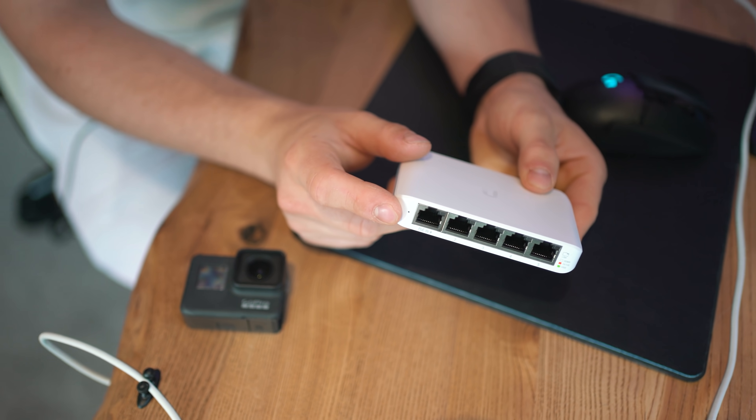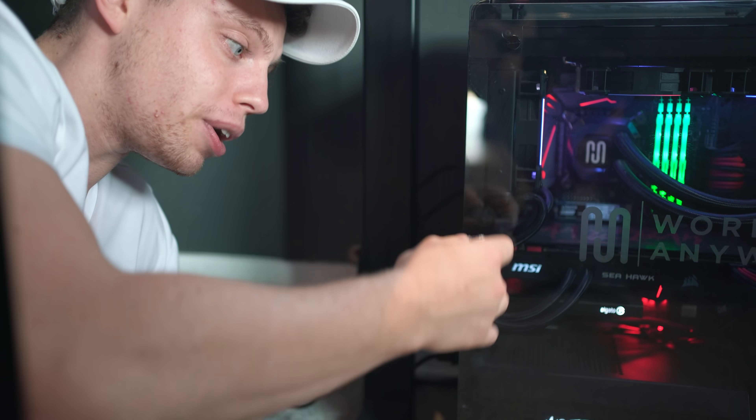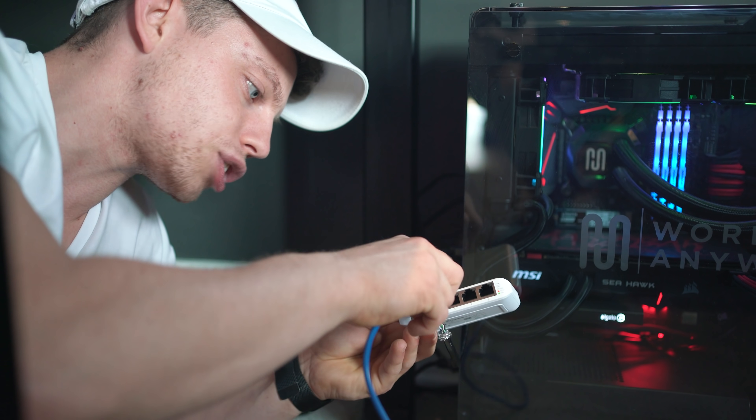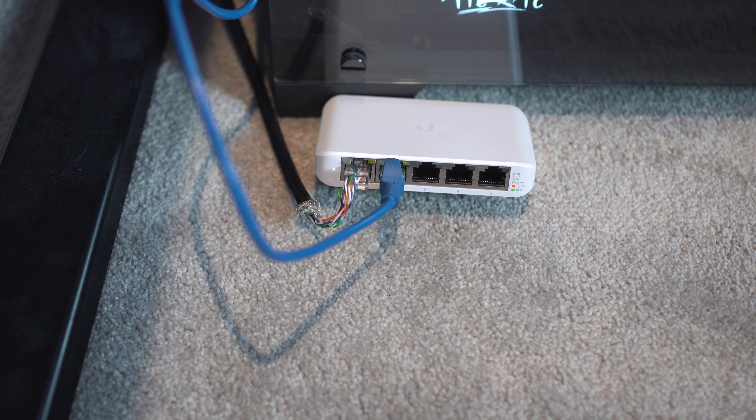This is really kind of funky — we're going to be putting that huge antenna on my roof in a little while. But this is a brand new switch from Ubiquiti that's going to be my brand new office switch. Look how small this thing is — it's even smaller than I thought. This is called the Flex Mini, and one of the reasons I really like it is because it's powered by USB-C or PoE-In. The switch we installed in the rack has PoE, and all the ports around my house are plugged into that switch. So no matter where I plug this in my house, I've got four extra Ethernet ports. If I take out this Ethernet cable patched up into the rack in the loft and plug it into here, it should provide PoE power to the switch — and it is, it's come on. Now I take this small patch lead, plug it into the computer, and now my computer has LAN and Internet access, plus three spare ports for other devices.